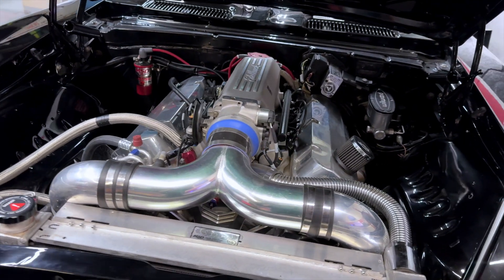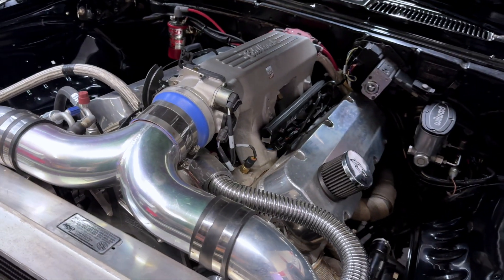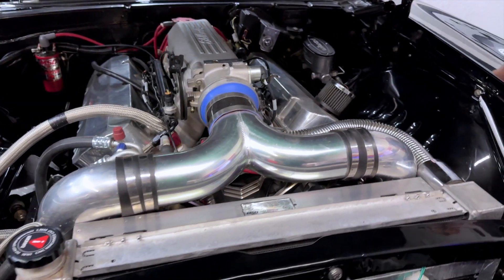It takes a little bit of doing to get one of these up and running. If you think you're just going to bolt it on — with an engine that's got 565 cubic inches, a big block — and it's just going to run and self-learn, you're probably in dreamland. You're going to need to take time to get the fueling correct, get the cam specs correct, and walk through each one of the menus inside the Pro Flow system. It's fairly straightforward, but Wally's going to have his work cut out for him to get this one running correctly today.